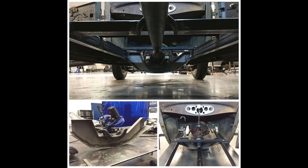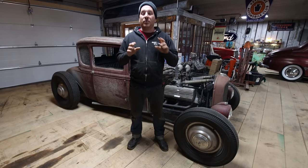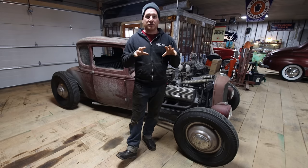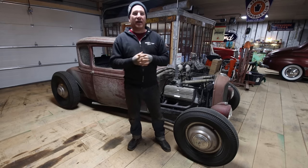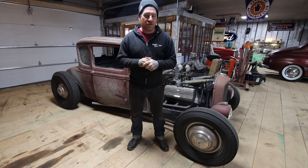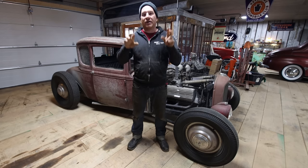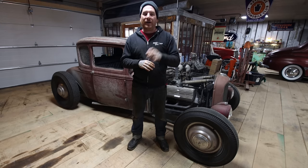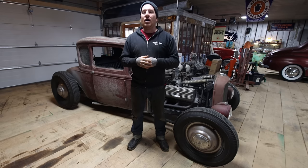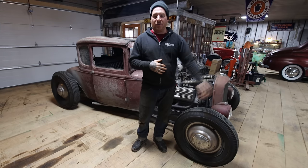For the pedals, this car uses F1-style pedals. I used a Haworth House of Fab crossmember — basically a recreation of the F1 crossmember — welded into the frame, with F1 pedals. The nice thing is those pedals house and hold the master cylinder, so you can put it right on there and save a lot of fabrication. I had to shorten the pedals and heat-bend them to get the right angle, but now with stock '40 Ford-style pedal pads threaded in, it all looks standard. The car also has a mechanical clutch using F1-style mechanical clutch linkage — a pretty much stock 10-inch clutch, so the feel is much like an original car and not too difficult to push in.